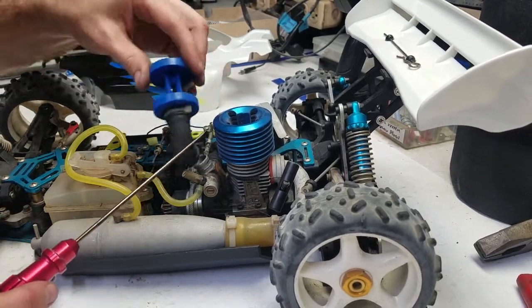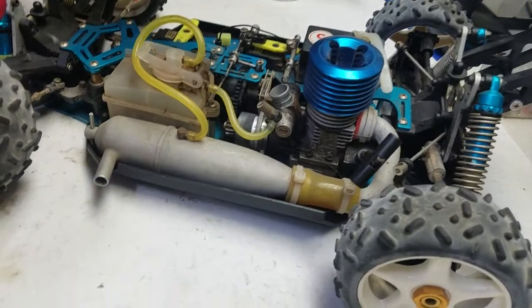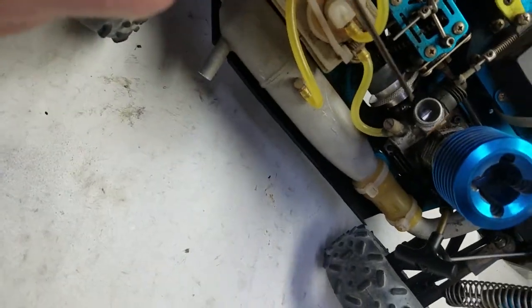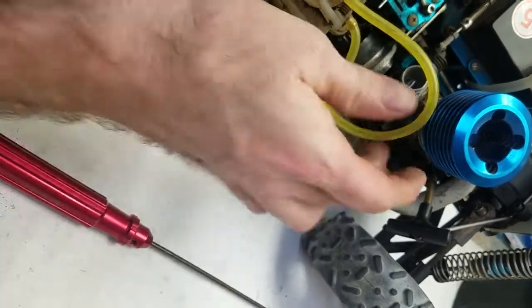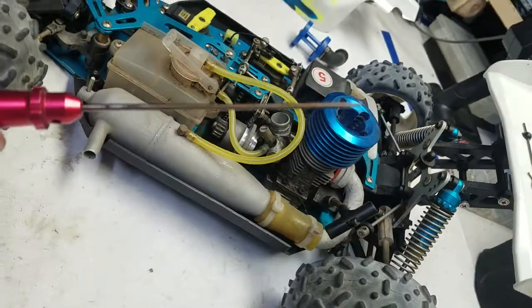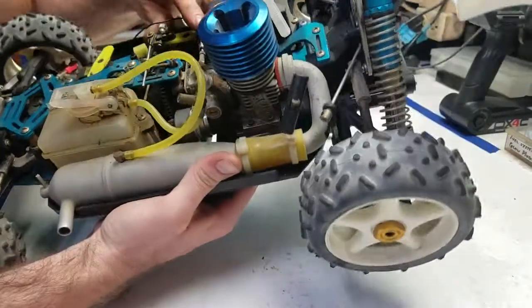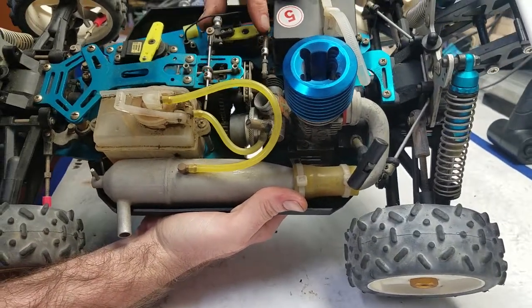A point I'm going to really hammer home with these vintage RC cars is it can be hard to find parts, so you really don't want to ruin anything or throw anything away until you're positive you have a replacement — or better yet, don't ruin it to begin with. Here's our low-speed needle — that feels fine, manipulating pretty well. And our idle set feels good too. Only a little bit — don't move it too much. Now we're going to take off the air filter. It doesn't have a filter element, but it has the filter housing, so that's something we'll have to install before we reinstall that whole assembly.